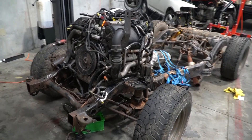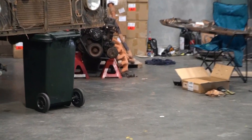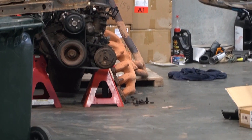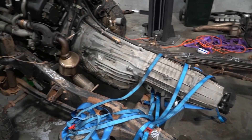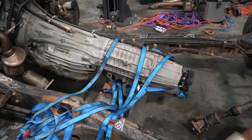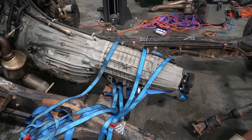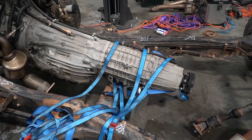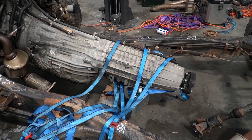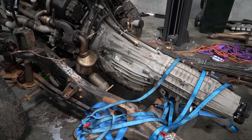What I've also found out is that this entire engine assembly is about 100kg lighter than that disgusting piece of petrol over there. Now there are a few other things, like the height of the gearbox, to consider. But at the moment where it's sat now, it's pretty much at the perfect height. It's about 350mm from the bottom of the crossmember to the top of the gearbox, which is exactly the same as the gearbox that came out, even though that gearbox has a huge mountain here with all the manual transmission assembly.